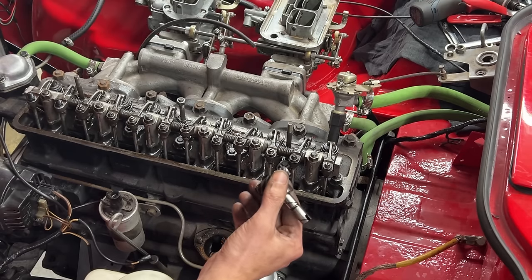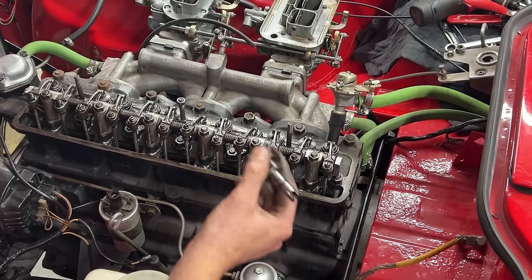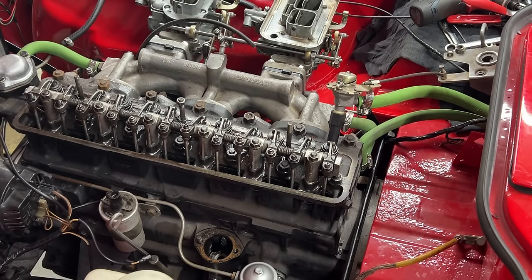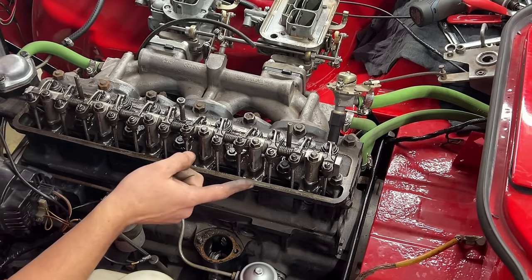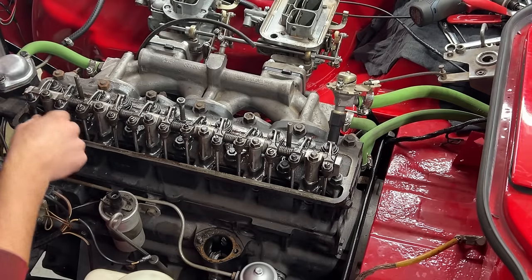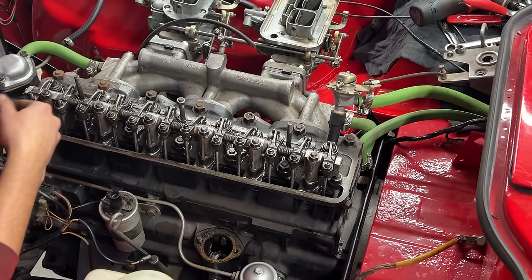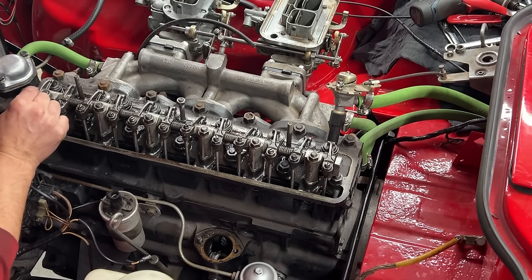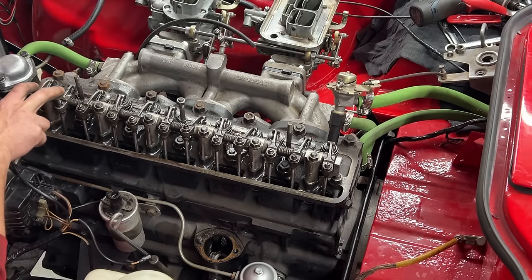So now let's see where the engine is. Oh, it's right here, I didn't see it. Actually, the pulley shows me top dead center right now. So let's see if that's top dead center of the first cylinder firing stroke or the sixth, because we have two top dead centers per cycle, right? One is on the firing stroke, one is between the intake and exhaust. So here, these two don't move at all. This means that probably they're between the intake and the exhaust strokes.